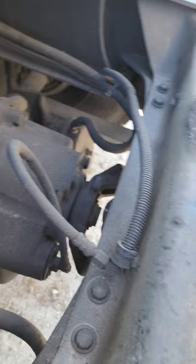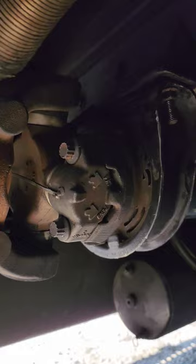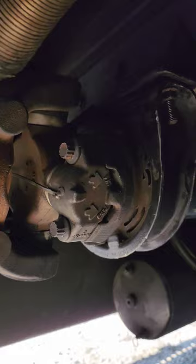It cannot be mismatched. If you raise your airbags, you'll notice this angle actually goes up. This is at the carrier bearing. To match that angle, you have to shim the plate at the top to lower it and change the angle to match. The angles have to match.